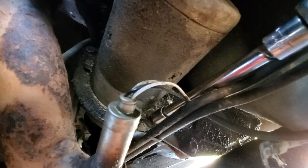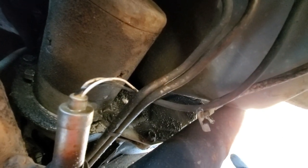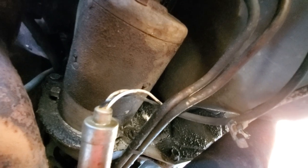You can see there's one bolt on the bottom that my socket is currently on, and there's another at the top — right there, I'm tapping on it now. It's got a bunch of oil and gunk on it, hopefully you can see that. We just need to remove those two and then finagle the starter out of position. Both bolts require a half inch socket. I'm going to remove the bottom one first so that the top one can support the weight, and then carefully remove the top one and pull it out.